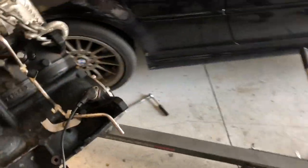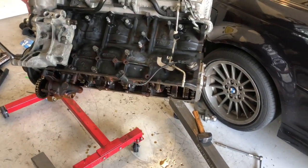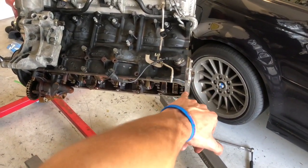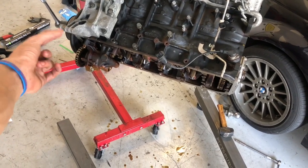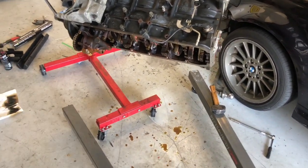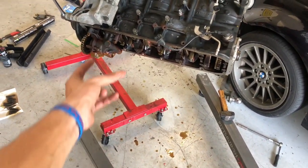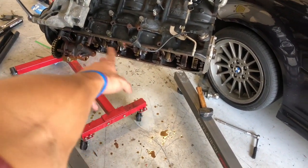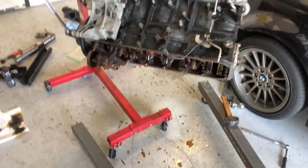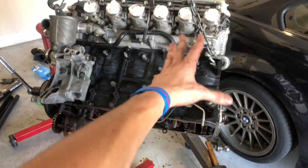And yeah, it's coming together very nicely. Not too many hiccups, so that's good. After I torque that rear main seal down, I'm gonna torque the nut for the oil pump gear and put the little pickup tubes back in, and then put the new oil pan gasket in and secure the oil pan in, and then just start piecing this engine together.